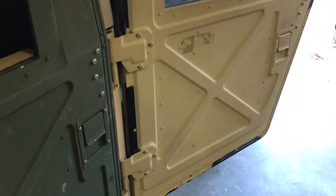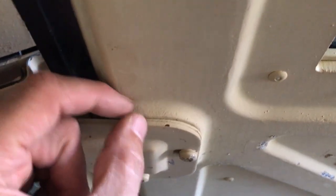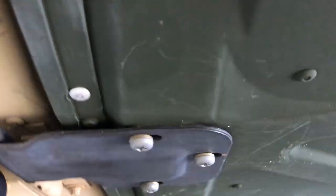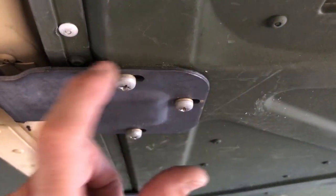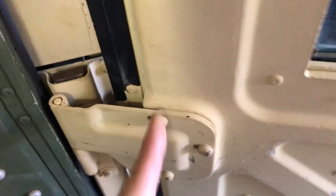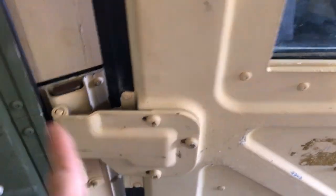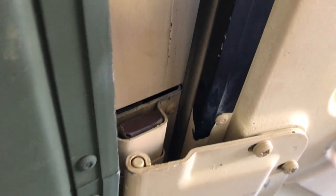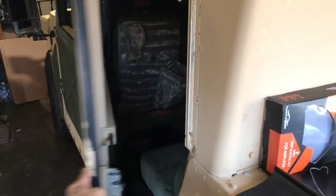The second challenge you'll have if you want to use a straight X-door on a normal non-up-armored Humvee is the spacing at the hinge mounts. I'm going to guess that's about a quarter of an inch of buildup of fiberglass compared to no buildup on a regular X-door. So the entire door is offset about a quarter inch outward. When you put it in the same hinge points and go to close it, look what happens — the inner edge of the door hits the door frame and I can't close it. Literally, that's as far as it goes. I can't even get it to close all the way.